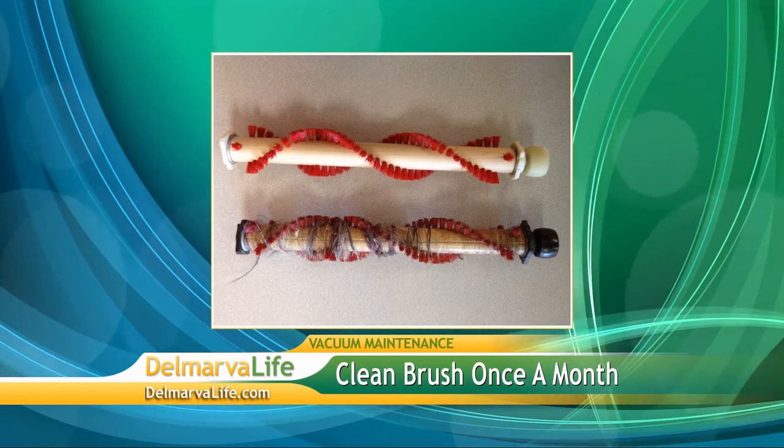Okay. One thing you guys do is you actually clean the motors. Why is that important? Well, that's important because, like I said, dirt getting into the motor can cause damage to it and wear it out prematurely. So it's very important to keep that dirt away from the motor. Keeping your filters clean is definitely the first step, but it's also not a bad idea that every couple months, if you have an air compressor, just give it a quick blowout. Get all that extra loose dust out of there, and it will make your vacuum run better and last longer. Yeah. Very good information. It's like your car. You got to take care of it. Exactly. And it'll run forever.